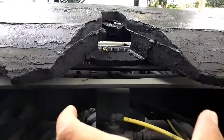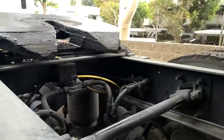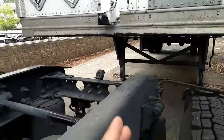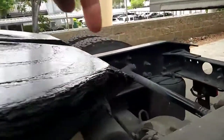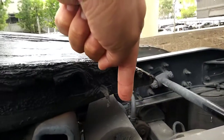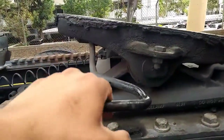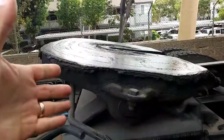Since you have this amount of space to hook it up, that's why it's very important for you to be aligned — because if you're not properly aligned, you're going to miss the trailer. In rare situations if you're not aligned, sometimes the pin, instead of going inside the gap, will hit the pin here and keep sliding to the side. In the worst scenario, it'll bend the release handle. Once this thing is damaged, the fifth wheel cannot properly lock to the trailer, and it's a big mess.